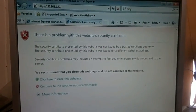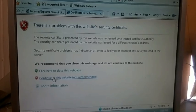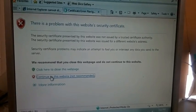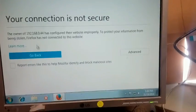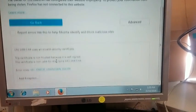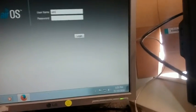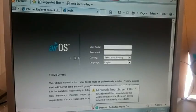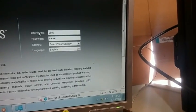Open up a web browser, go to 192.168.1.20, press enter, and then you'll need to continue to the web page because it is HTTPS even though the certificates are invalid — that's common with all UBNT devices. If using Firefox and it won't let you in, you actually have to add the exception permanently so that you can then continue and sign in.